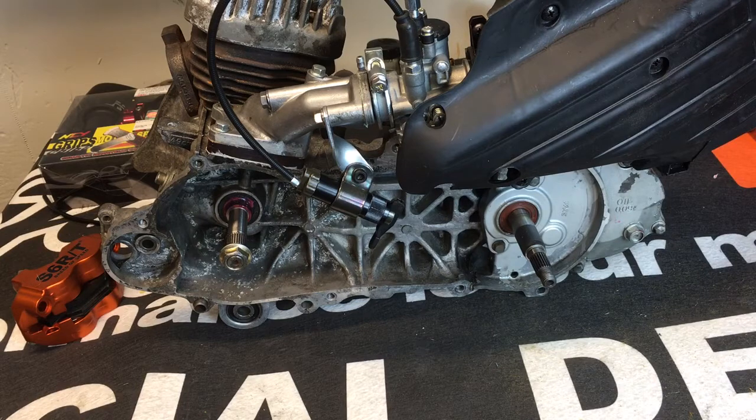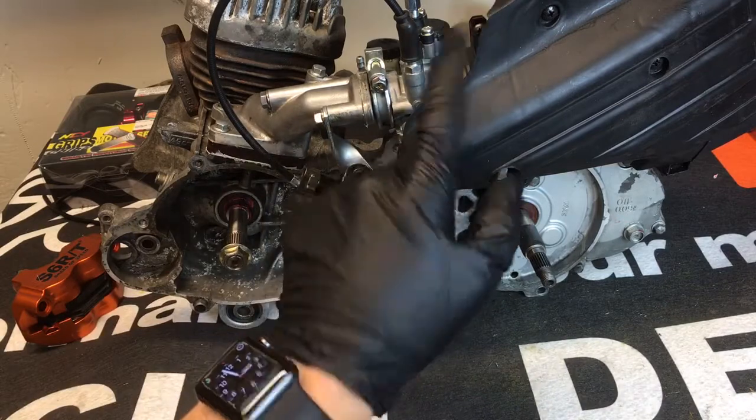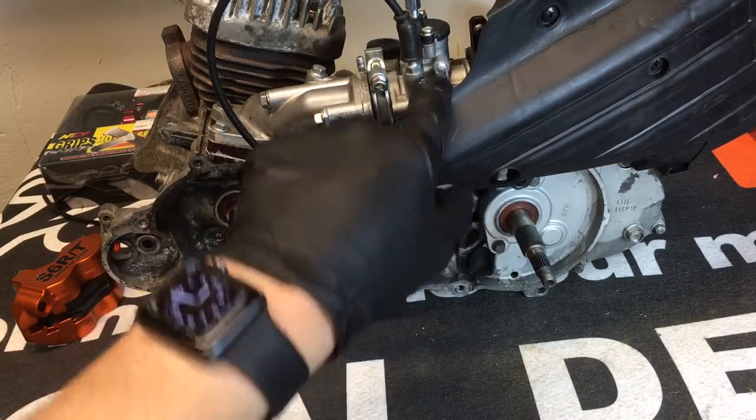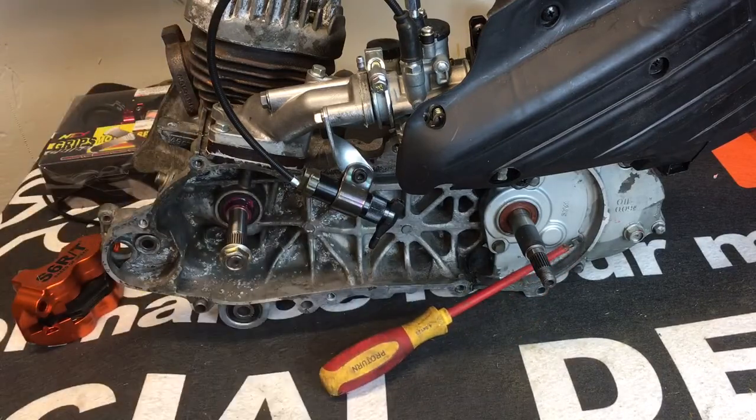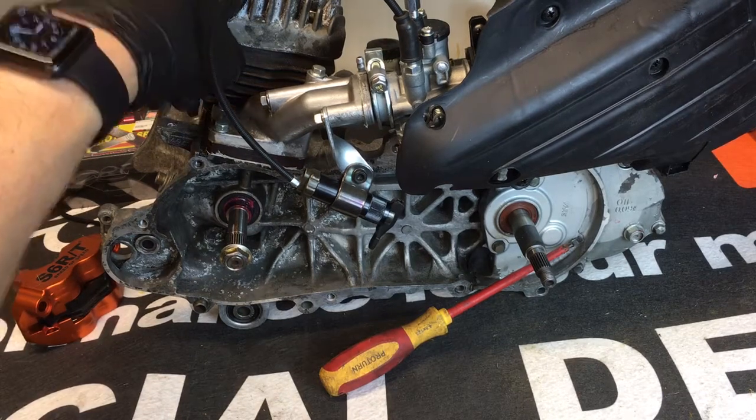You won't be able to tune the bike because you can't tune your carburetor to match the amount of air that's coming in somewhere else in this section. That's a quick overview of what air leaks are, where they come from, and how they affect your engine. It's pretty easy to check — only takes a few minutes.